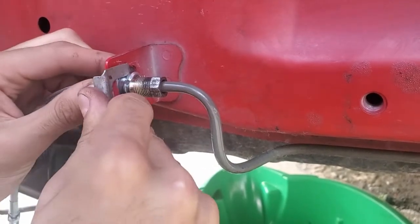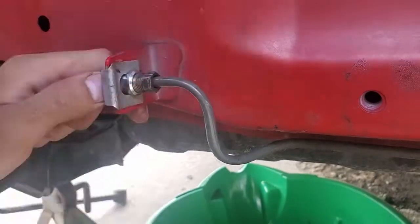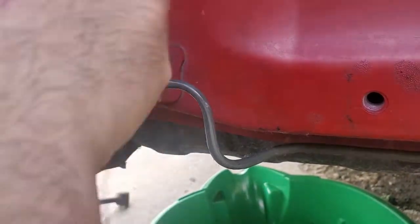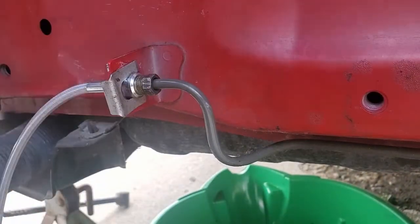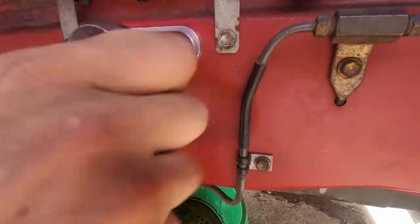Next is the custom clutch line. I'd already removed the old clutch slave cylinder, as this transmission does not have a clutch fork — rather, it is purely hydraulic. You just need two wrenches to tighten this line, and then install the front side motor mount.